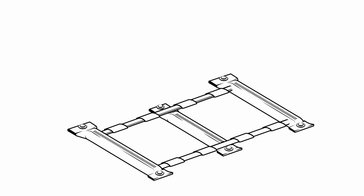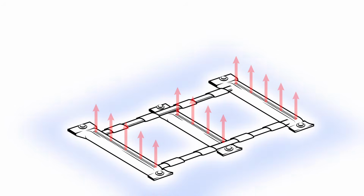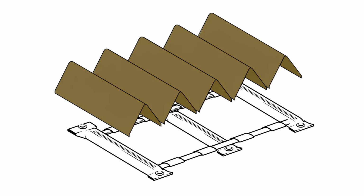Without them, you'd have heat just coming straight up from the flaming tubes, so you get hot spots over them and cold everywhere else. With the flame tamers, the heat comes up, hits the flame tamer, splits, and spreads. And in the best grills we tested, there were even a few extra flame tamer bars or similar constructions, which were great because they spread that heat even more.